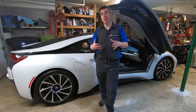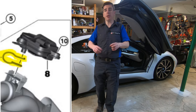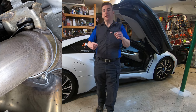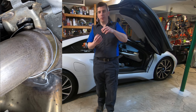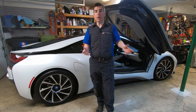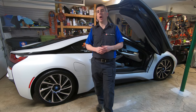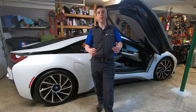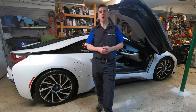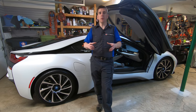My first attempt at opening the exhaust valve was removing the actuator, removing that little wire, and then taking another piece of wire to run around the part of the flap to keep it open all the time. I drove the car around and it was great. I put it all back together and drove around for a while, thinking about what else I could do to open this valve — and that's when I discovered the actuator was controlled through a fused circuit.